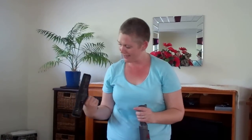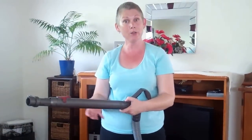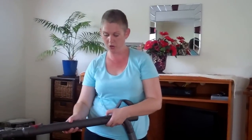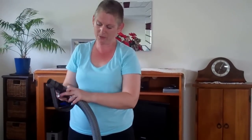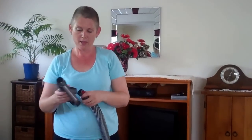We can see in here there's nothing stuck. If the suction still wasn't that great, this particular vacuum cleaner also comes apart here — and I can see this is the bend, which is going to be another place where the vacuum cleaner could clog. So usually you can find it because the clog is going to be somewhere here or somewhere in there. Always pick up things first and put them in the bin so you do not get a clogged vacuum cleaner. If you get a clogged vacuum cleaner it's going to take your time to fix the problem, and if that takes you 15 minutes off your cleaning time, expect that you're going to be here 15 minutes at the end of the job still finishing.